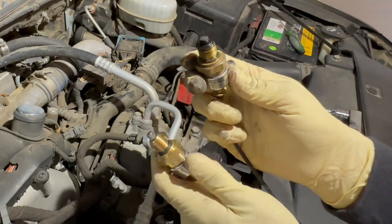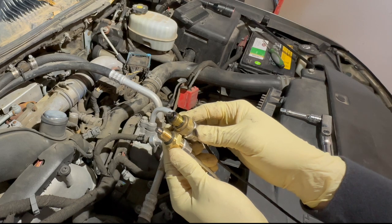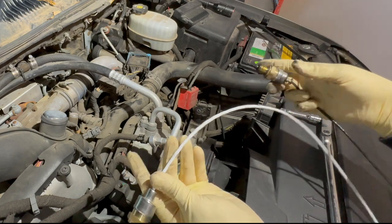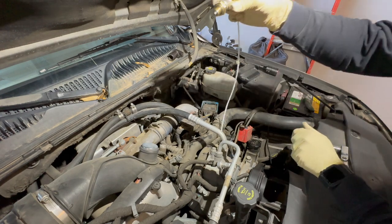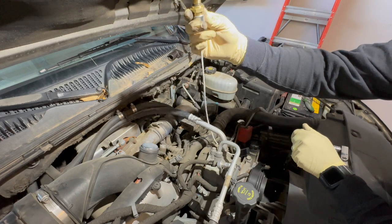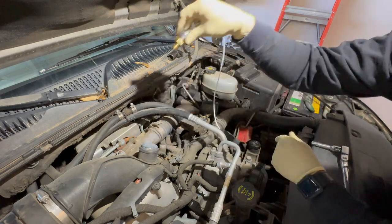Make sure you visually inspect the old sensor and the new sensor to confirm they look identical — you don't want to install something completely different. This one is pretty dead on. New sensors do come with a white wire harness, but I believe that's the case even through GM, so white is okay. Make sure the sensor is clean with nothing stuck on it. This does have an oil seal on it, so you don't need to put anything on the threads.